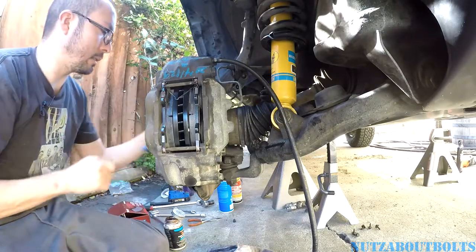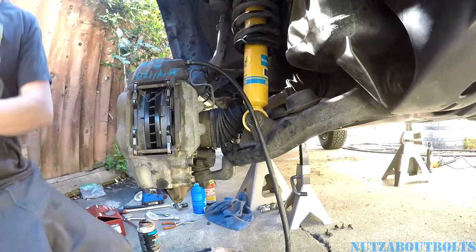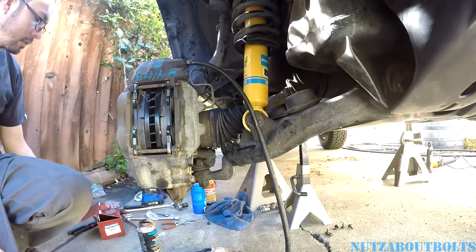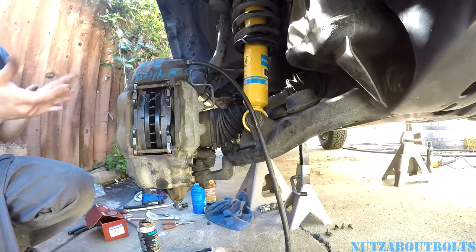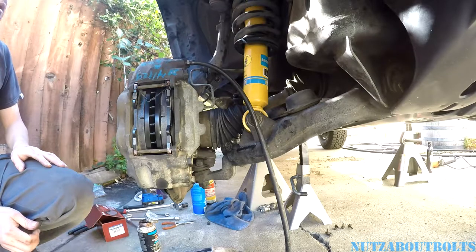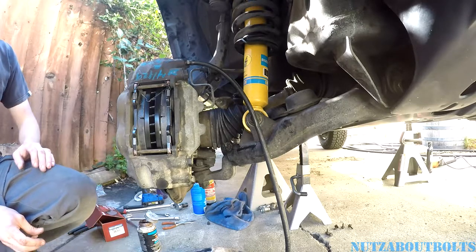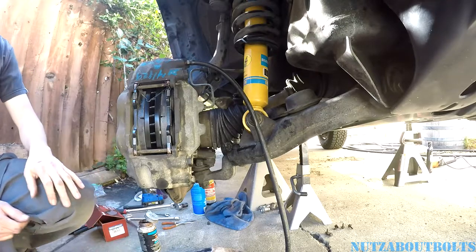Let's see how our bleeding process is going — the fluid coming out is pretty clean because I already flushed these brake lines. I'm going to continue with the bleeding process and make sure the air is all out. Another thing you should do is definitely follow the directions for breaking in the brake pads, or I think they call it burnishing them. Usually you're supposed to stop a few times slowly at like 20 miles an hour and then brake hard a couple of times at like 30 or 35 mph. That will help the performance of your brake pads. Torque the wheels down properly, double check everything, and make sure your fluid level is at the proper amount in the master cylinder reservoir.